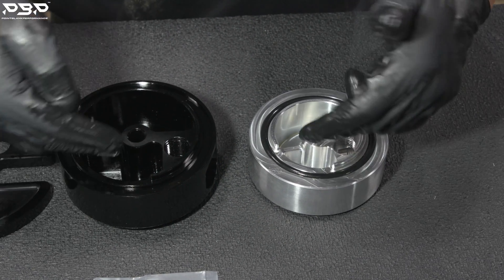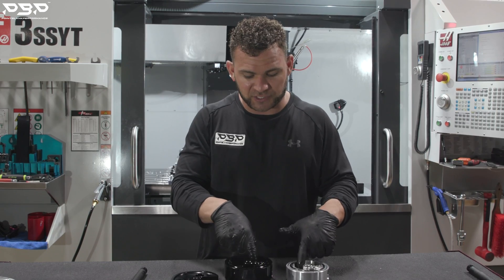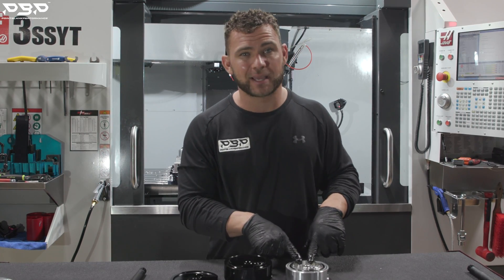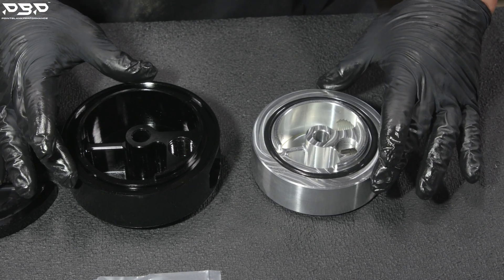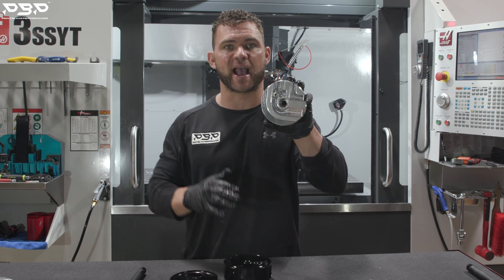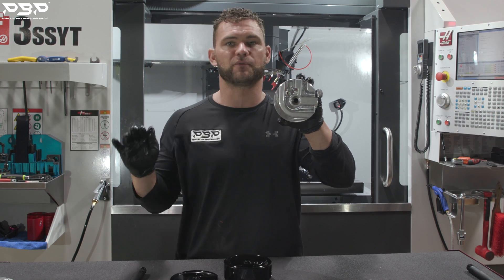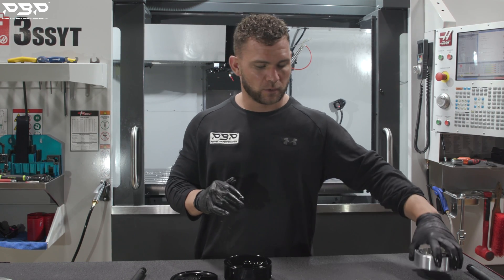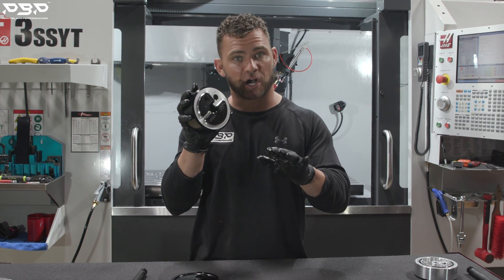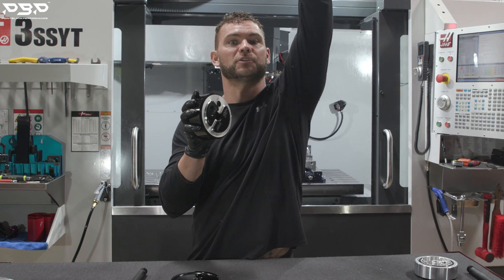The fuel comes in, fills up this port, jumps over the bridge, and rushes into this tunnel — this is a dash 10 — flowing out to your fast fuel system. The baby Pac-Man is a dash 8. Big thing to take away: the baby was engineered for 800 horsepower and below, which is perfectly fine. But we're focused on the e-racers and that 1,000 rwhp. This sump can also start at stock power and go all the way up to 1,000-plus horsepower.